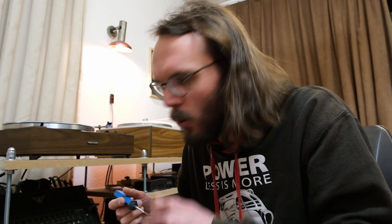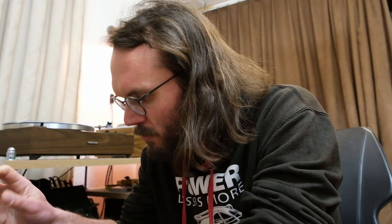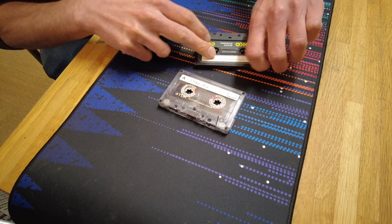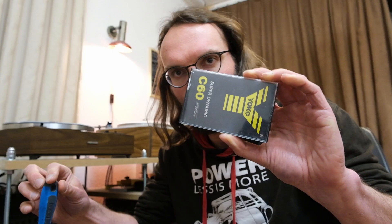First of all, let's roll up my sleeves and take both of these tapes apart. Got a nicely fitting screwdriver — kind of important if you do this kind of stuff, because you don't want to mess up the screws or have those tiny little screws disappear. There are two ways of doing this: you can put the reels from one cassette into the other, or actually wind the tape over. It's more original if you wind the tape onto the reels, because then the reels will be correct for the model of cassette.